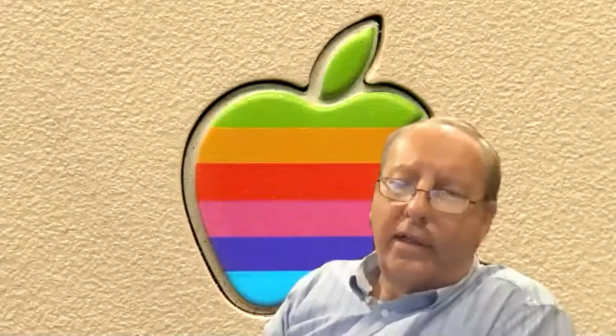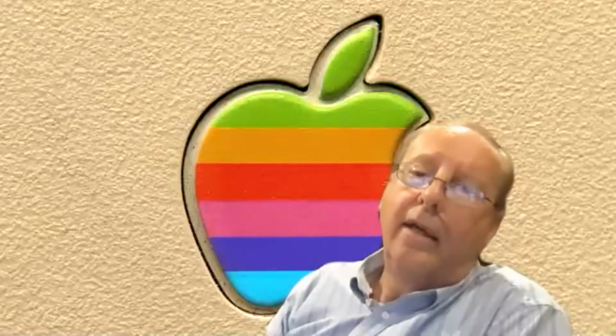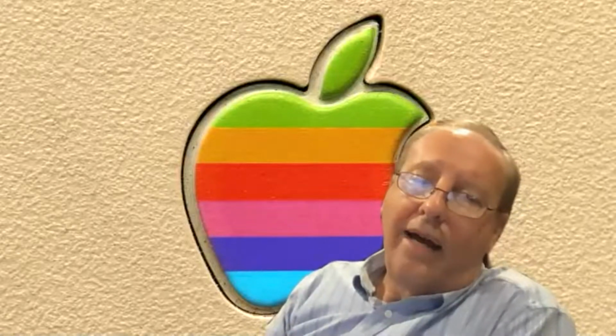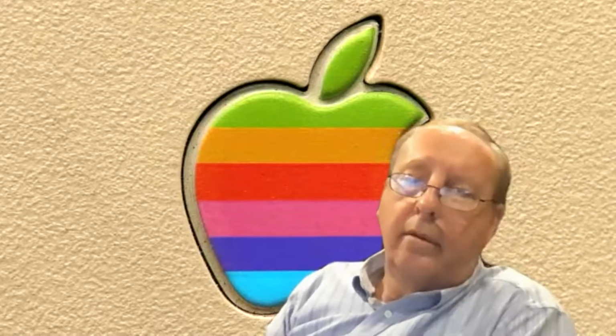I have a 4 terabyte Buffalo NAS. It's a number of years old. I paid like $600 for it at the time, and I configured it as a RAID 5, so I can lose an entire drive. I have 4 1 terabyte drives in it, and if one of those drives goes bad, I can yank it out, put a blank one in, and it totally reconfigures itself, and I haven't lost anything. So at this point, I do not have it backed up anywhere. However, if the ultimate catastrophe hit, then I would be in a world of hurt.